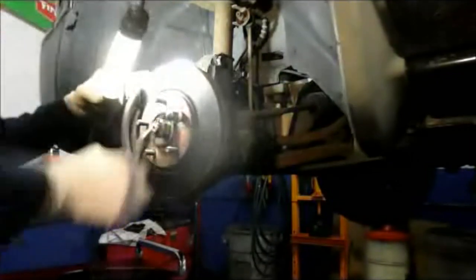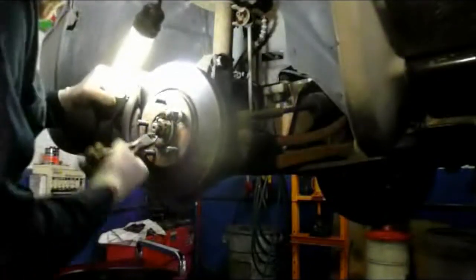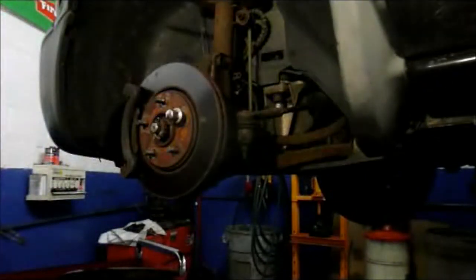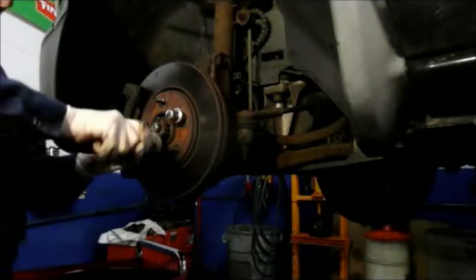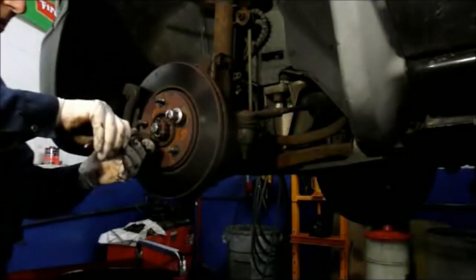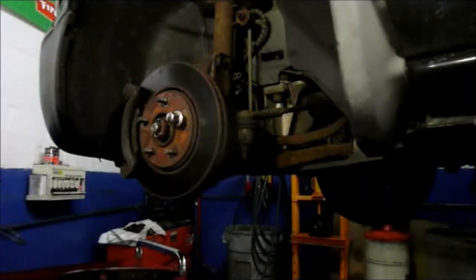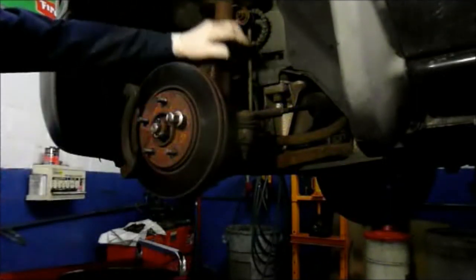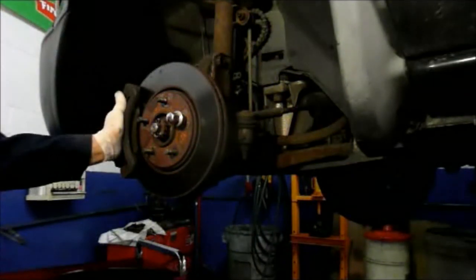Then you take the cotter pin and you bend these pieces of the cotter pin out to the side. Same thing on this one here. Alright, then your axle's in. Your axle is in. Your two bottom strut bolts on here are tight. Next thing we're going to do is put back on our caliper, and we're going to wrap this job up.